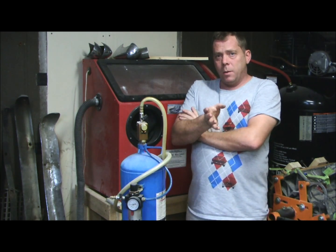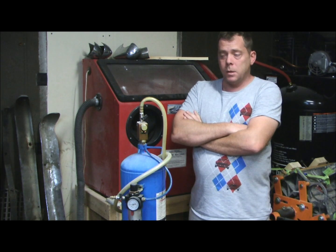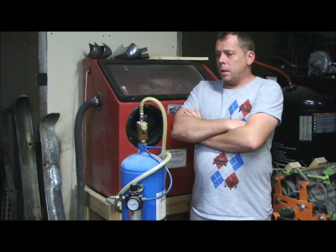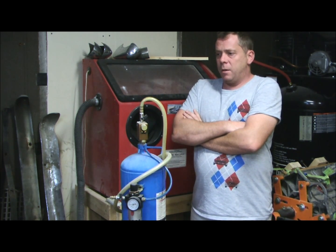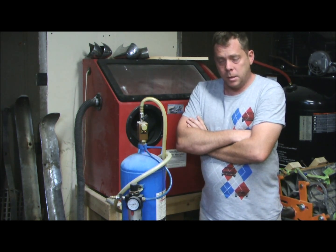On my vintage cars, particularly the British ones, there's a ton of aluminum. When you want to clean it up, basically the only option is to sit there and wet sand it, which is a miserable experience. But say, for example, you have an intake manifold off of a Jensen-Healey or any other Austin-Healey Sprite, and you really want to clean it up — you want to soda blast it.